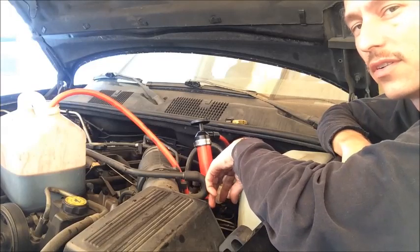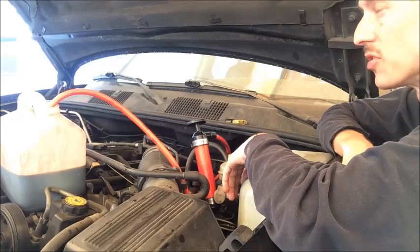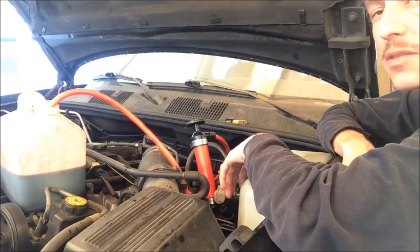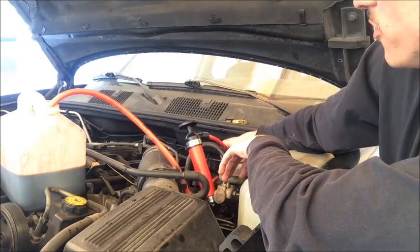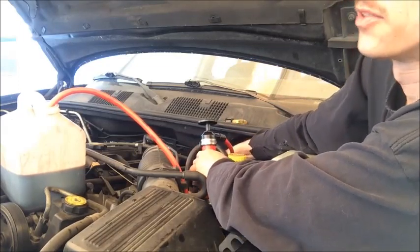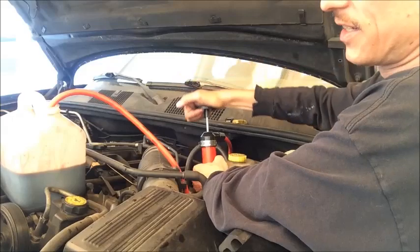The torque converter is draining fluid. Sometimes the transmission cooler in the front with the radiator is draining fluid. So you've made some space in there, and gradually some transmission fluid is gonna leak back down into that space. You can always move the tube around a little bit and make sure you're actually at the bottom. Make sure it's in the pan. And then just after a minute or so, go ahead and try again.